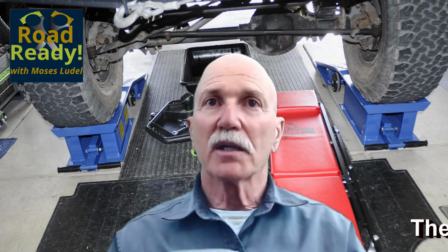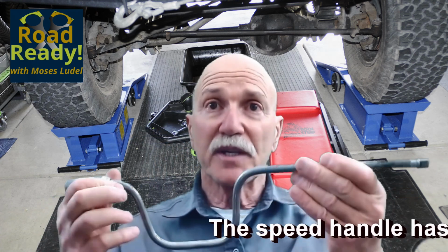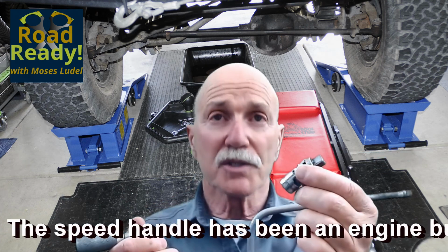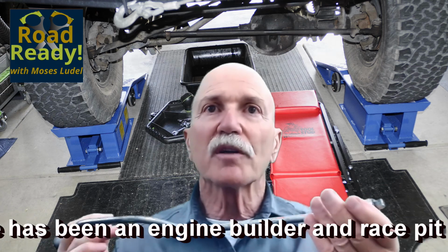An example would be this socket that has the rubber insert and is a straightforward 13/16 spark plug socket with a head that can be turned with a wrench if desired. This is 3/8 drive like the two Snap-on sockets are. Believe it or not, some in the day and even to this day use a speed wrench for removing and installing spark plugs. A universal swivel is highly recommended, as this will enable some sort of give, if you will, at the spark plug.